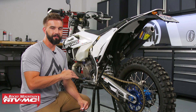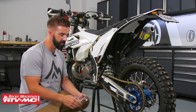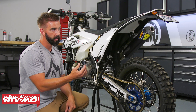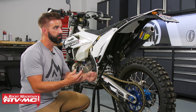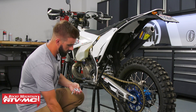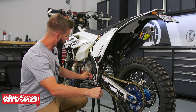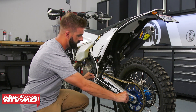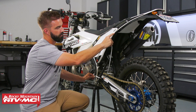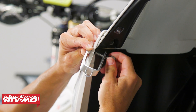To get this installed and ready to use, it is a very simple process with only a few steps. First, you want to know where you're going to put your clamp that the cable will attach to. On some bikes like newer KTM and Husqvarnas, they will actually have a location pre-marked on the fender for you. If you don't, here's an easy way to check: take a rope or a piece of string — you could even use the Slacker V4 itself — go from the center of the swing arm to the center of the axle, then make an arc until you come in contact with your rear fender or side plate. Once you have that location, that's where the clamp will go. You could mark it or drill a small hole so you know exactly where to put the clamp every time.